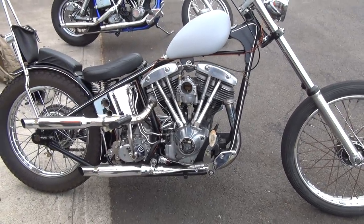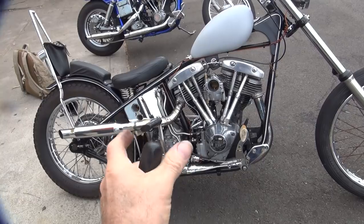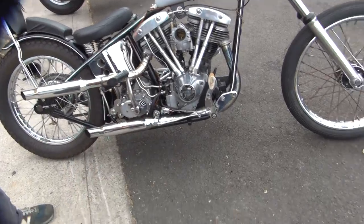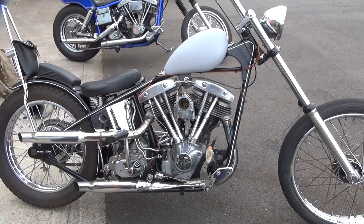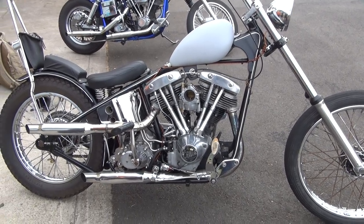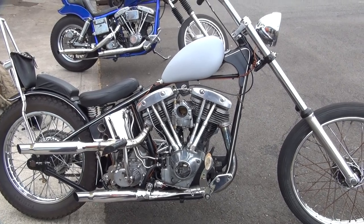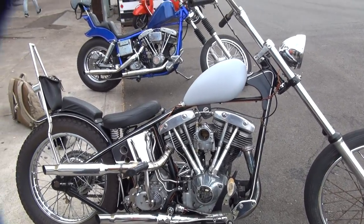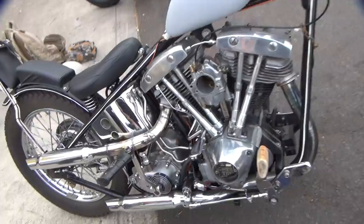For some reason, it liked it. Here, where's this going to? Well, it's close, because when I'm adjusting the timing while it's running, it wants to be in kind of that area. So we're in the right area. So maybe the tiniest bit. Well, 3 or 4 degrees makes a difference, but we're close. That's why it still runs. But the thing is, something was way off, and the way off part was the choke was wrong. That was wrong, because it's breathing through that hole right there.